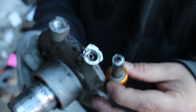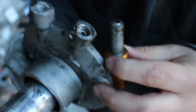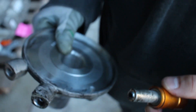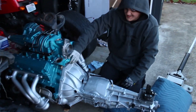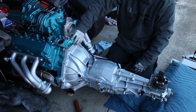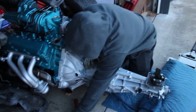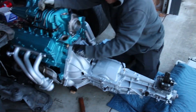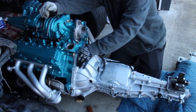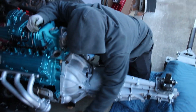We can put it on and test fit it — we're just going to need to go back and replace that, as well as the bolts in there. Kinda sucks. We're going to go ahead and just push on — that's broken and not going to be replaceable today. We got the transmission in. Literally all it took was just lining it up and wiggling it. I guess the only reason we didn't do this last weekend was because we just ran out of time. But we got it in just for testing — we don't have the throwout bearing or anything in there right now. We just wanted to get everything lined up so we can test fit stuff.